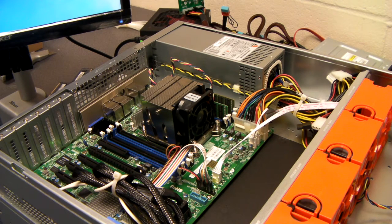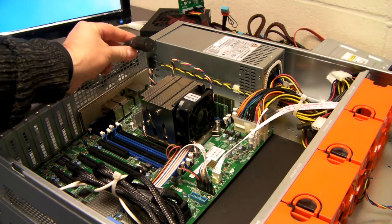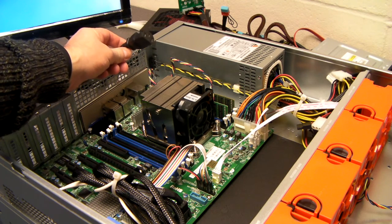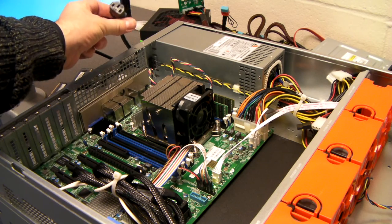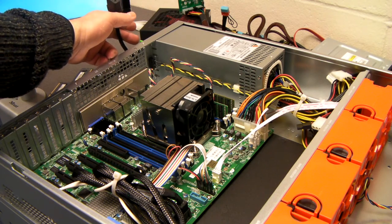This particular system is fitted with a redundant power supply. We use redundant power supplies from AS Power — Platinum rated. The advantage of a redundant power supply is that you've got two power leads going into two single modules. If one is removed or fails, you'll get a warning, which you can turn off with a switch at the back, and the system will just continue quite happily until you remove the module, which is hot swappable.